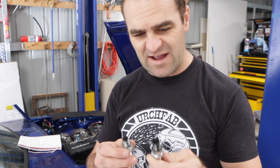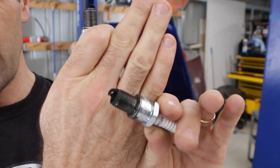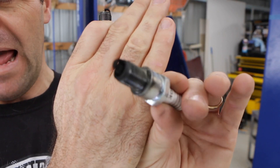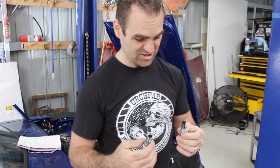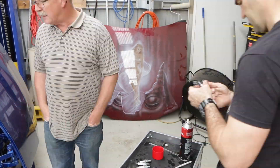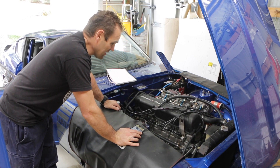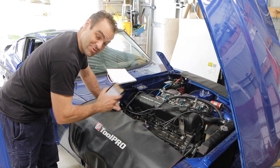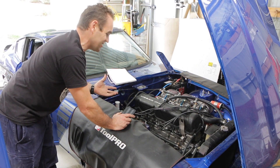I was trying to start it the other day and it was running absolutely horribly. You can see plug number three is the worst — it's very black and carboned up. A lot of the others were quite wet, probably because I was cranking it trying to get it to start. We've cleaned and gapped the plugs and they look much better. I also had the immobilizer left on from the 1-2-3 ignition distributor, so I've turned that off, and hopefully it should start now.